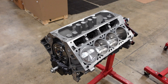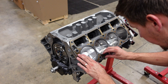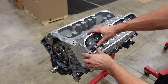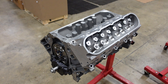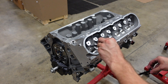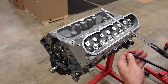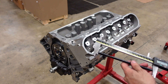Before we put the heads together we're going to go ahead and check and find our pushrod length as well as measure our piston-to-valve clearance in this combination. Because we're going to do piston-to-valve on a hydraulic roller setup, we're going to have our lightweight checker springs installed. I'm going to throw in some bolts just around the cylinder that we're working on and just lightly zip these down.